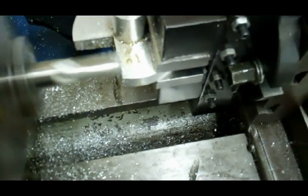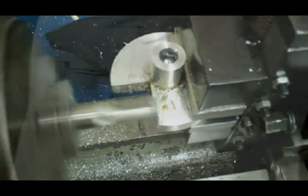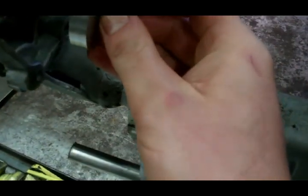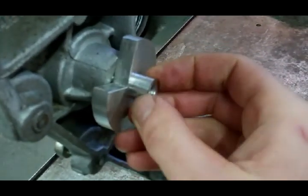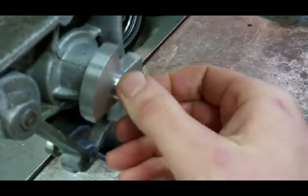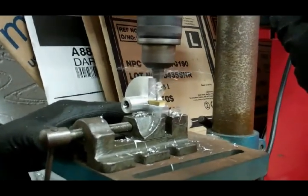We're going to mount on a hardened tip which is going to be drilled through and screwed on — one on each side — to basically cut down the alloy frame when it turns in the mounting. Here's the sketch I'm working from, and here's the basic tool made. This is how it's going to work: slot it in the frame, it twists around and cuts down the mounting lug — five millimeters on each side. Next thing to do is put some cutting tips on — those brassy kind of things are the cutting tips.